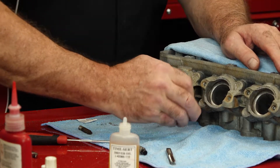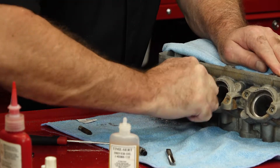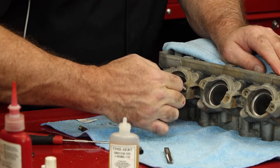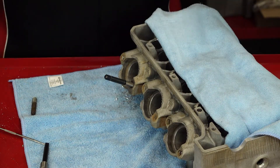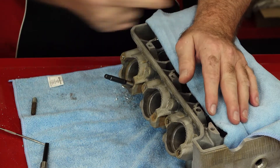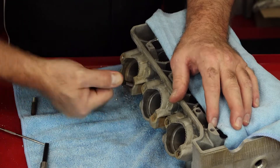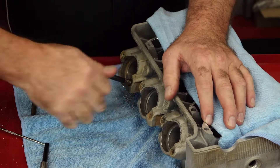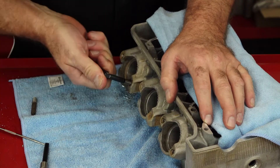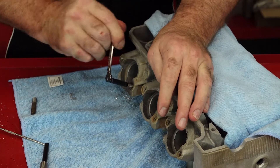When you're doing this, you don't want it to catch anywhere. Now it's bottomed out on the flange, which is what we want. When we drive this all the way in, it's going to expand out the very end of the Time-Sert and that's what's really going to hold it in place. The threadlocker? That's just an insurance policy. Now it's pushed that into the aluminum — this is actually stronger than just the stud going into aluminum, and that's been proven. I have zero concerns about this.